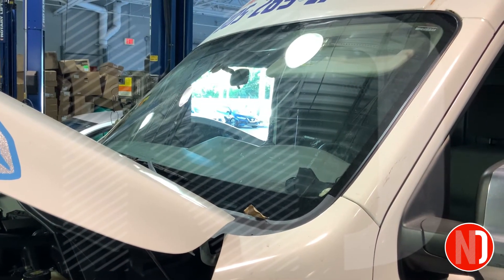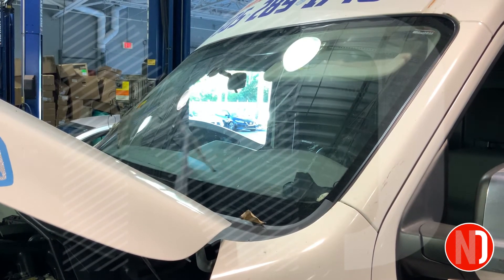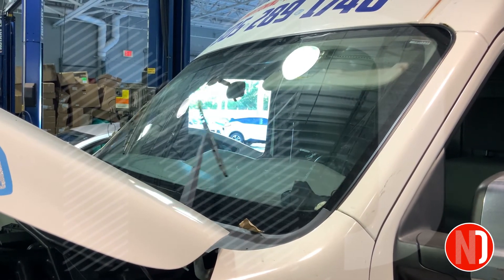The IPDM self-test. First, we'll check the wipers on all speeds. Second, the lights — low and high beams. Third, the AC compressor clutch. And fourth, the electric fans.